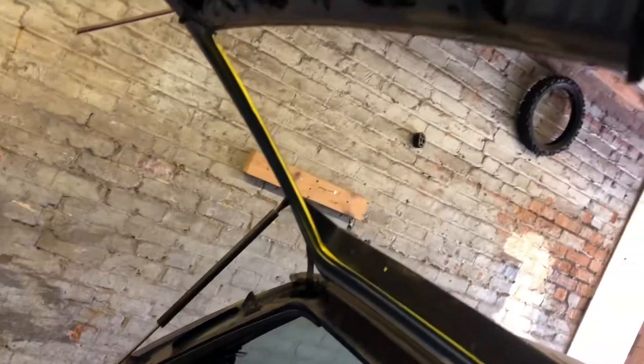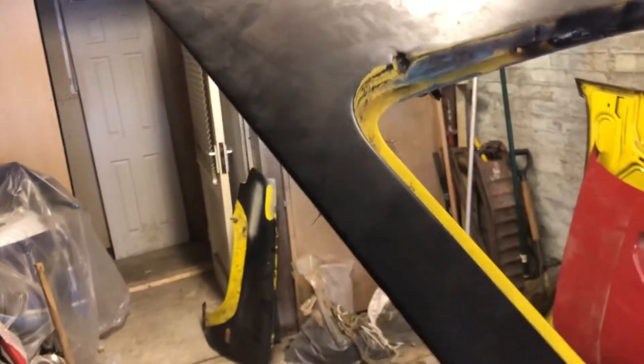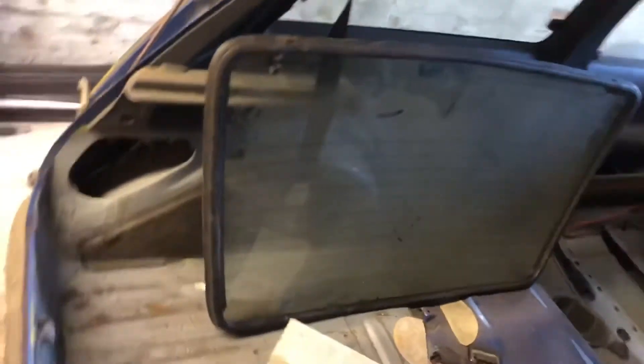So we've done this side, we've done a bit up here in the boot lid — I took the glass out to get to that. Done a bit round here, that just needs flattening down. I might actually put a bit of zinc primer in there quickly, otherwise that will rust. We've done bits in here, the floor was all good, and that's the rear window there.